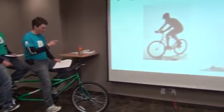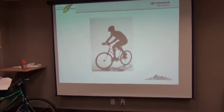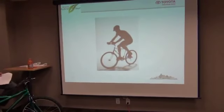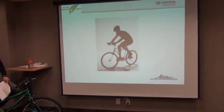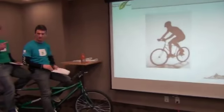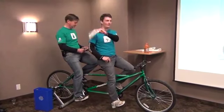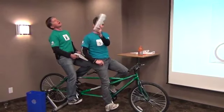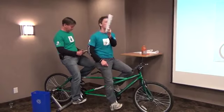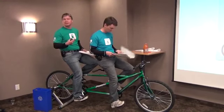Take a look at this slide — a single rider bicycle. That bicycle rider is the sole power source, representing a gas engine vehicle. Since that person is the only power source, the only way he or she keeps cool is to keep on riding. In other words, the engine has to stay on to run the heating, ventilation, and air conditioning systems, thereby using fuel and wasting it. In a hybrid vehicle, I can have my HVAC system on and keep Glenn cool, because I know the energy I'm using right now I'm going to recoup later, once we get started. To summarize: the powertrain is at rest, but all the systems are operational.